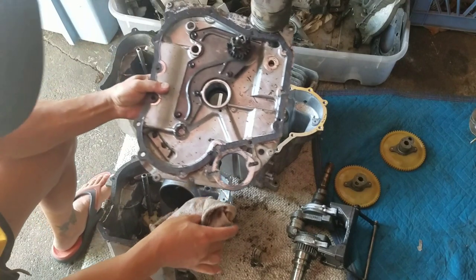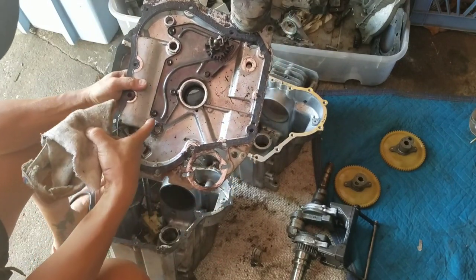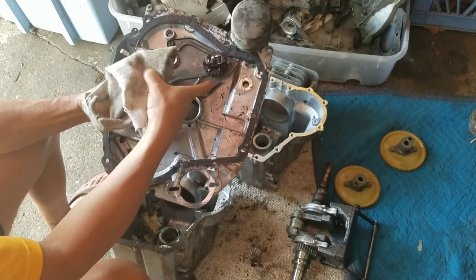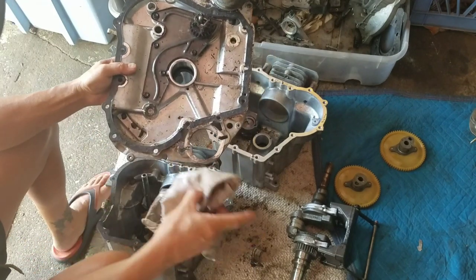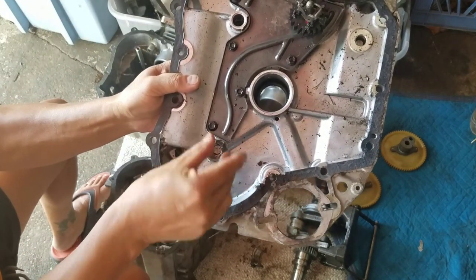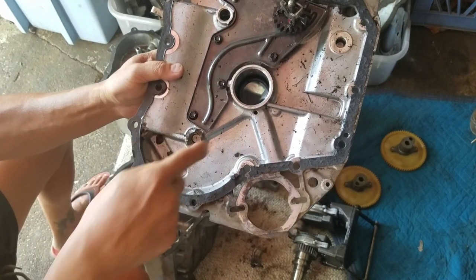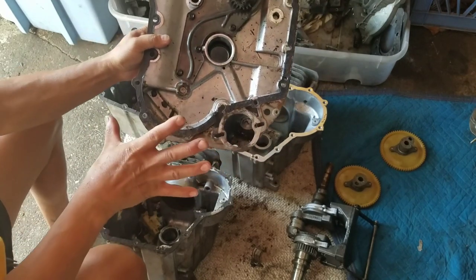I have this other sump cover that has the governor on this plate here that's removable. So I'm going to remove this plate that has the governor on it. That's in good condition, and I'll replace it under there. The reason why I can't use this one here is if you look carefully, this part here, the rod broke the housing of this post here, see? So this sump cover is done-ski!